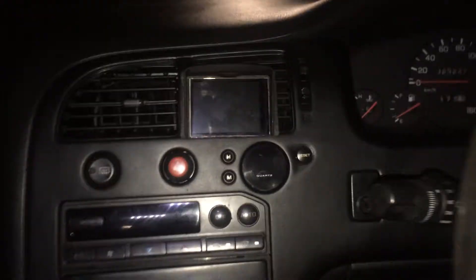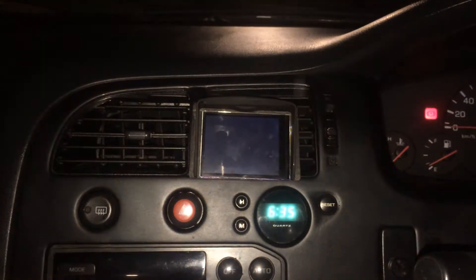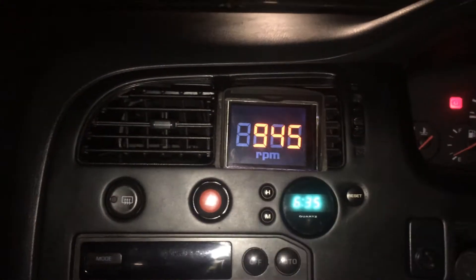So if I insert my key, the Raspberry Pi turns on and if I crank the car it won't cut out - getting the immobilizer off so it doesn't cut out. It takes about 30 seconds for the Raspberry Pi to turn on at the moment because I haven't got a build route set up to try and boot it quicker. It's a bit tricky because with the Pi TFT I'm using, you need to load the custom kernels to load the Pi TFT.